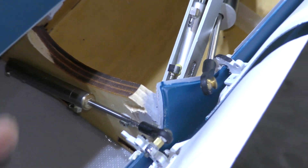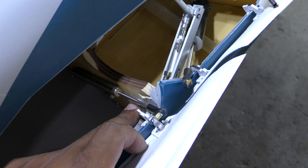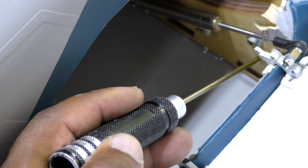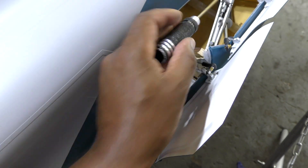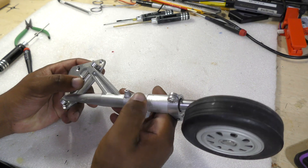Taking off the support rod is also quite painful. One screw is clearly visible, but there's a second one hidden right in here under this hinge, which is a pain to get to. Those are the two screws to undo, and then the support will come off, the gear will come off after you undo the four screws, and the cylinder will come off.